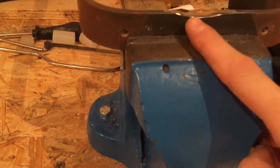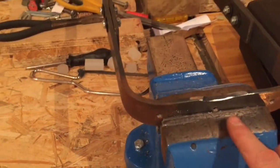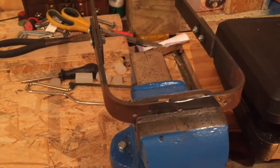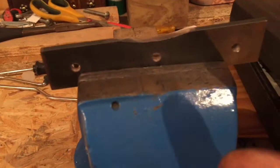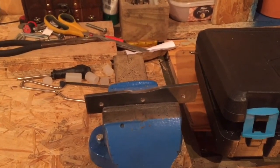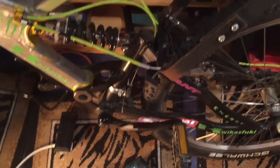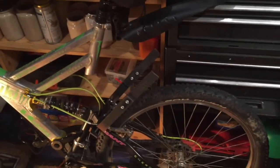For this part here, this is the bracket. I'm just putting a groove because when it gets on the bike I need a space for this cable to be free and not be getting jammed or nipped up — that's the reasoning behind this. Also this bit here that matches the back plate, just bring this down a bit as well, just to make sure the wire clears on both parts, because the tire will be close.